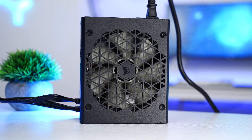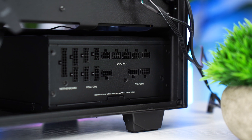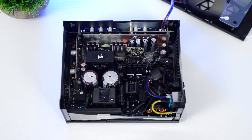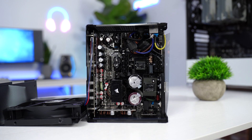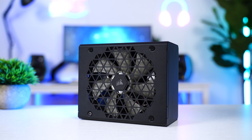That is the most connections and cables on the entire list. If you want a PSU that will last 10, 20, or even 30 years of continuous upgrades, this is something that's really going to future-proof your rig. With a max wattage of around 1600 watts, even in 20 years you'll likely be able to use this for high-end rigs — since realistically your PC is not going to draw more power than a single outlet, and Nvidia and AMD are not going to design components that overdraw that. When you open this up, you immediately notice it has really good airflow — Corsair pretty much always does well with their power supplies. There's a lot of room between components for cooling and a good amount of heat sinks without impeding airflow. The warranty is 10 years.